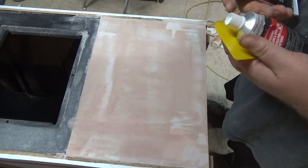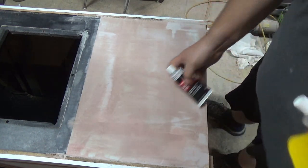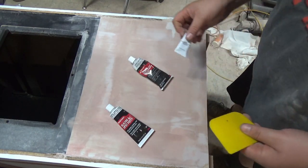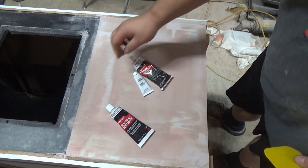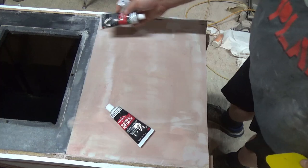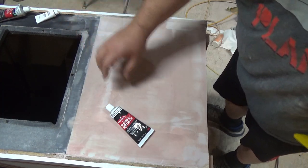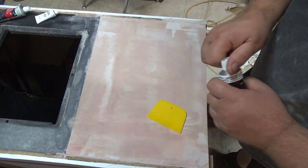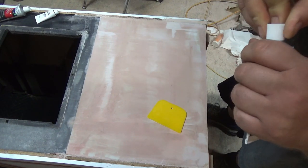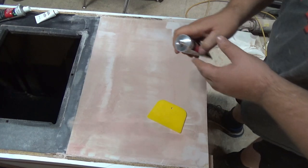And I found something. Here's a regular glazing putty that I usually like. And here's something else that says Bondo Professional Glazing Putty. You have to mix hardener, like Bondo. I tried this, and boy, does it suck. It's no different than just putting thin Bondo on. The reason I like glazing putty is because it reacts a certain way. It goes on super thin and almost instantly dries.